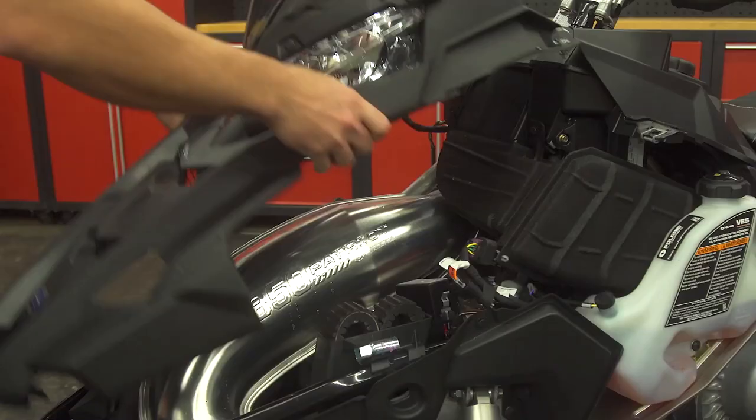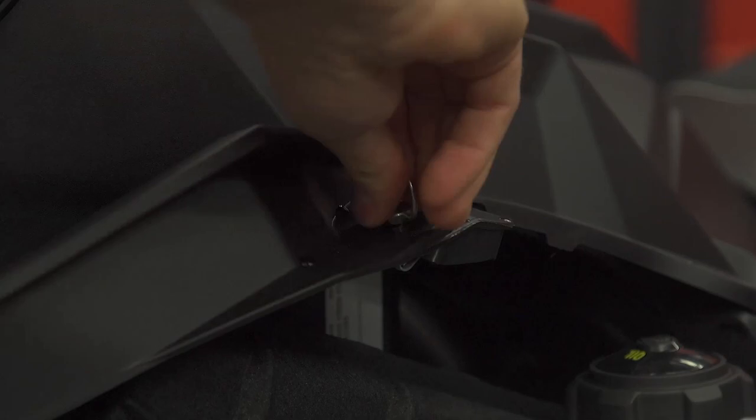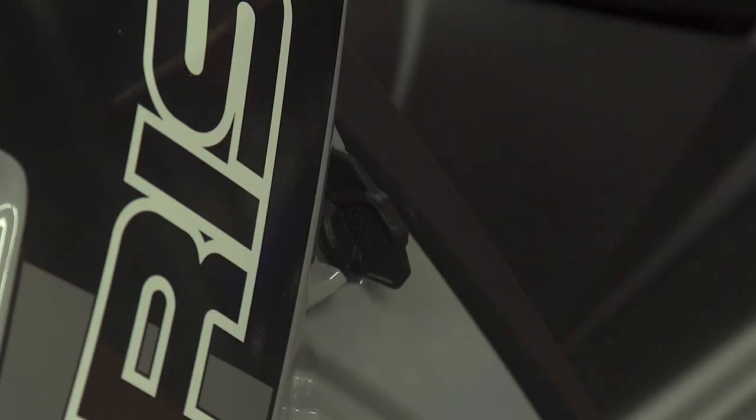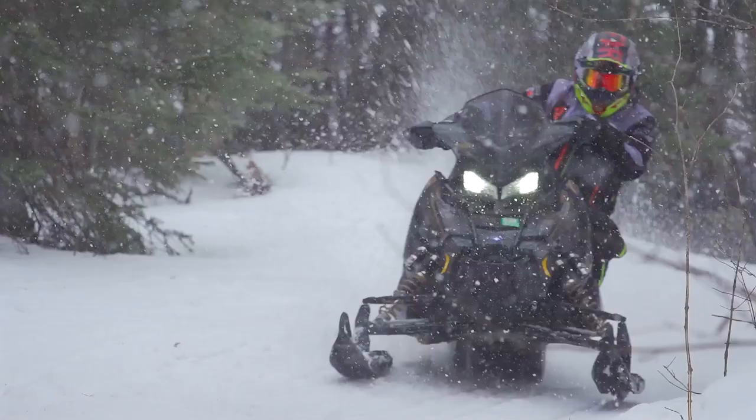Ensure you put the new Ultimax belt through the break-in process of half throttle or less for the first 20 miles. I know it's hard to do, but trust me, this is key to ensuring that you get the most performance and life out of your drive belt.